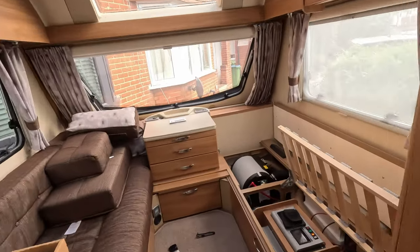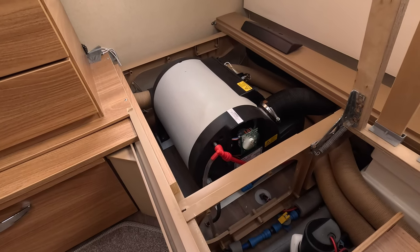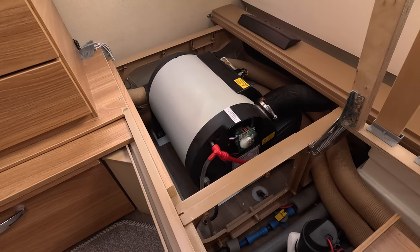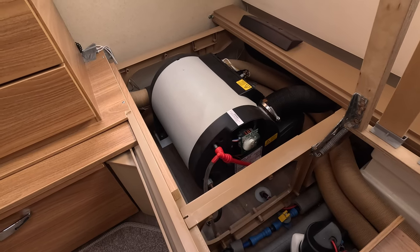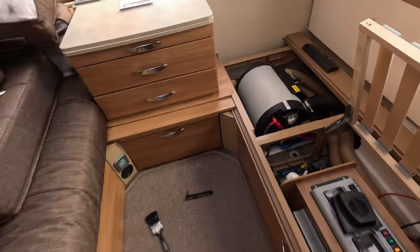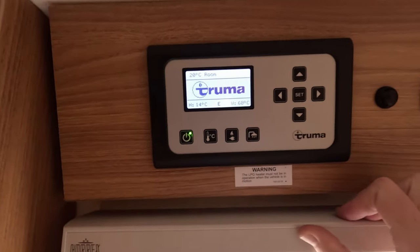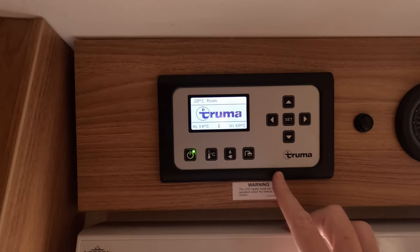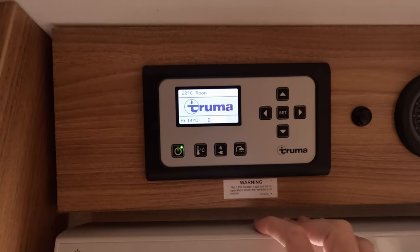So that's on — it clicked in and should spin up. With better luck it doesn't beep at us. And that is looking like it's doing exactly what it should do — that has solved our problem. No error message, water is heating up, and there is water in the system. So if you get an error six on your panel and no hot water, that definitely seems to be your problem.